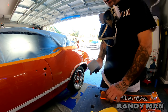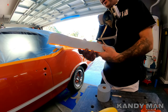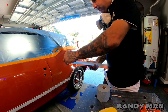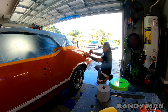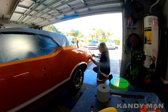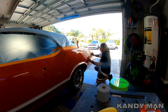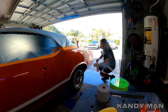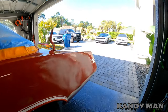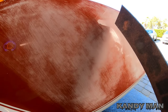I'm using 180 grit sticky and just going ahead and putting it on the block like you normally would. This is the first time I'm trying these blocks out so we'll be learning together. These are nice because they have handles on them. You just want to start out in an area - and that's the end of this paint job, so there's no turning back now. We can already see it's doing a good job identifying the low areas that you can't see.